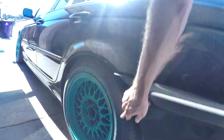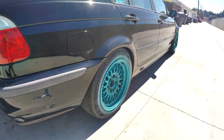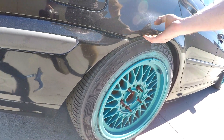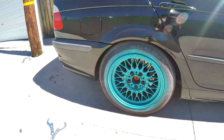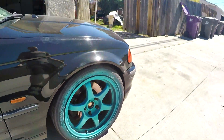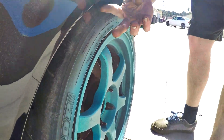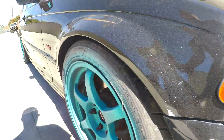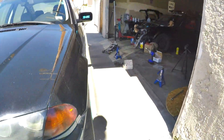Here's the back — this is a BMW Style 5 wheel, a 16-by-8 with a plus-23 offset, and you can see it is clearing by a mile. I need to figure out why this side is still lower than the other side after installing the Racelands, but I'll figure that out. And here is the front — now a 17-by-8.5 with a plus-28 offset — clearing by a mile. These are not rolled fenders, this is exactly how the car came from the factory with roughly negative-3 degrees of camber.